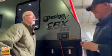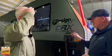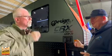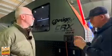That's your compliance plate. Just a tip with your tanks too, if you're storing this van, keep the tanks full of water. I know that may sound strange, but the reason why is because bacteria is less likely to breed in your tanks if the tanks are full of water. Yes. And some people like to travel with the tanks full of water as ballast. Apparently the caravans ride better with the water. Other people like to empty them so they're not carrying all that extra weight, because it will be a disadvantage on your fuel economy. But a lot of experienced caravanners actually have it full. It's a good tip. Thank you.